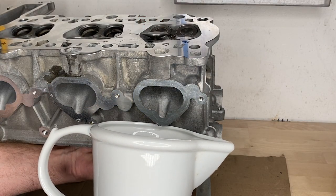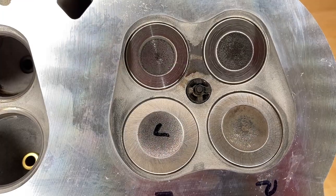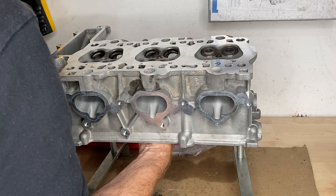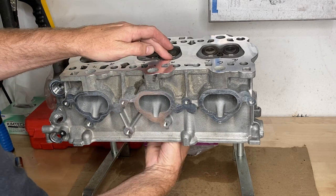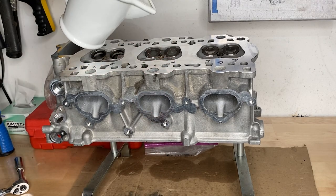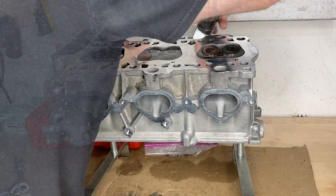I flushed that one out and decided to just keep on going for now — got an L on that one for leaky. On the others, all I'm doing is putting the spark plug back in — the old spark plug, not torquing it really, just making it tight — then sticking the valves in with no springs or anything, pouring the water in, leaving it for a bit, and then just having a poke around.